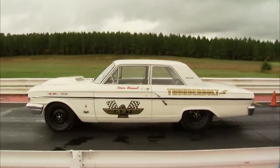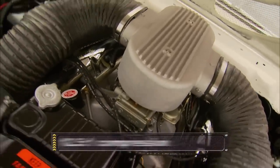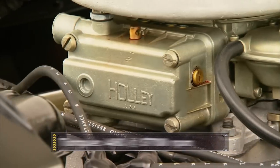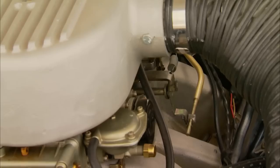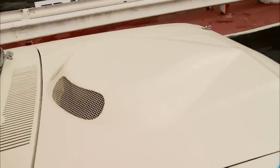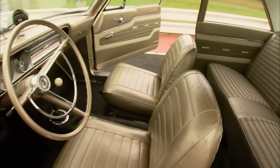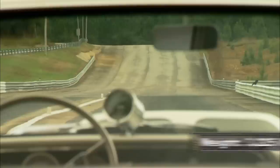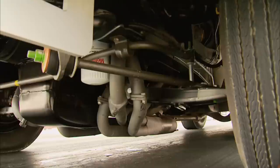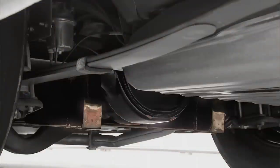The formula for the Thunderbolt was simple: big power and a little car. The monster 427 was shoehorned in and topped off with a high-rise manifold and dual Holley 4-barrel carburetors. Air was gulped in through tubes that looked like headlight bezels, rated at 425 horsepower — it made upwards of 600 in race tune. To shave off weight, fiberglass was used for the teardrop hood and fenders. The bumpers and grill were aluminum, and the windows were made of plexiglass. The insides were stripped down to the bare essentials: no heater, no radio, no carpet — just some van seats and a four-speed shifter and tach. All told, it came in just 20 pounds above the minimum super stock weight. Underneath, the suspension was beefed up with asymmetrical heavy-duty leaf springs and two-inch by three-inch rectangular traction bars.